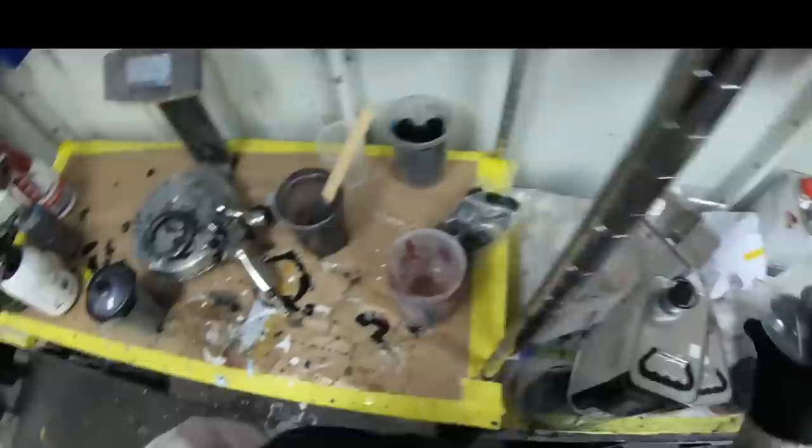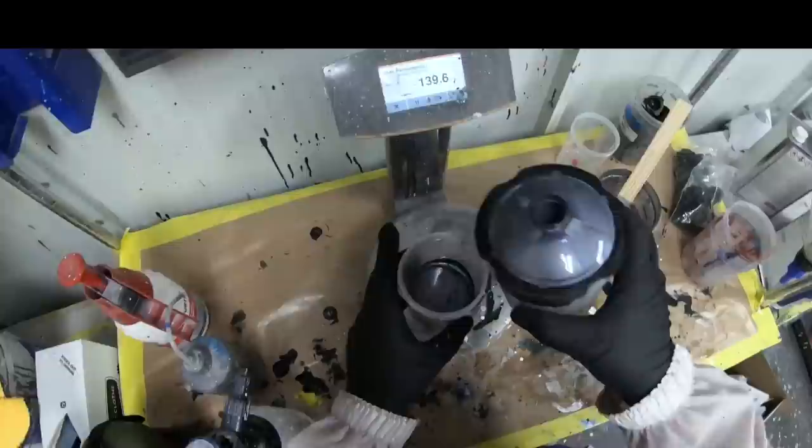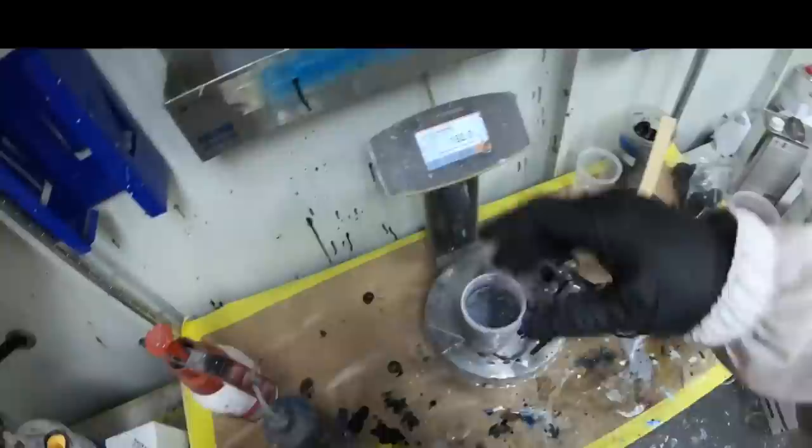So what are we doing here? This is another little tip and trick I'm gonna give you guys in this video. We're taking about 3 ounces of our color, right? Not any sort of blending additive added to it. You can tell I haven't used blending additive so far, but I'm gonna be using a blending additive here, or a clear base. It's the same thing. And I'll link one in the description for you. And I about halved it. So I used about 3 ounces of base, and then I put about 1.5 of our blending additive, and I added about another 1.5 of our extra slow reducer.